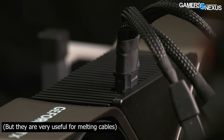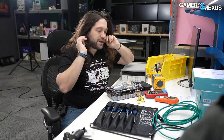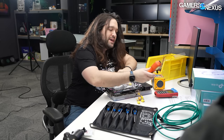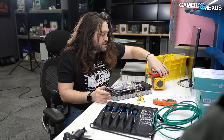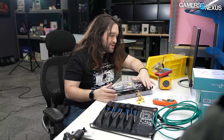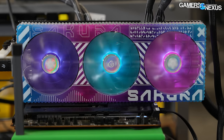You can also use thermocouple readers - we have an old one with relays that works great, and smaller handheld ones. For validation we use a laser tachometer to test fan speed, making sure the reading we get in software is correct. All of this is wired up very carefully internally - that's the hard part. We maintain a steady 21°C for all the tests.